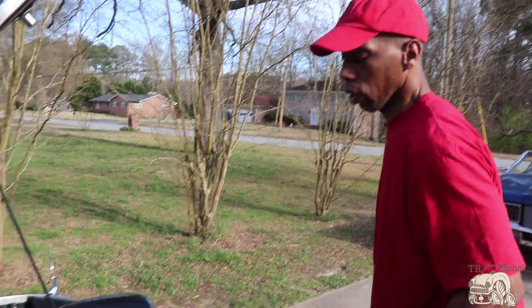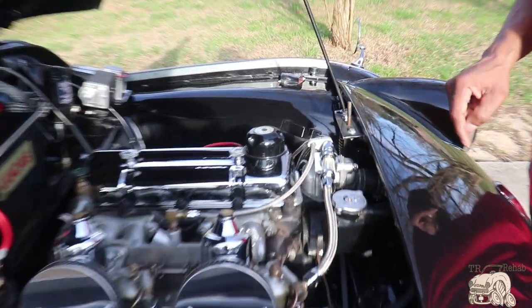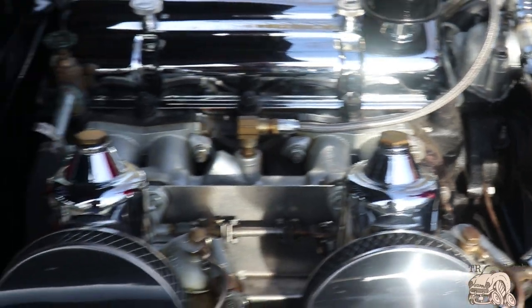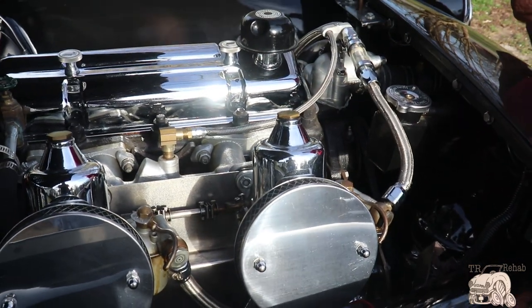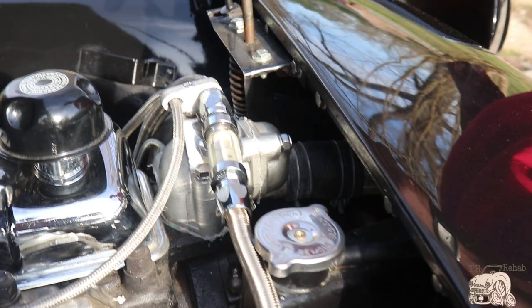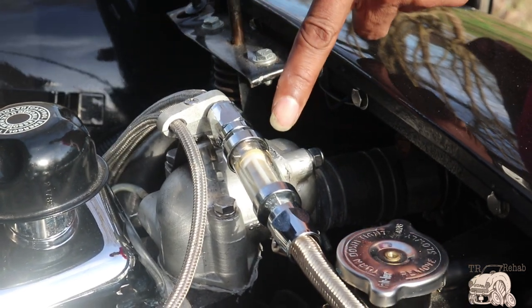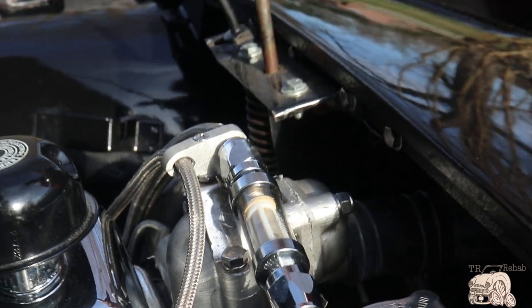Just as I suspected — when you don't need it to work, it works. But this is what was going on a little while ago. The bowl was empty, which let me know that the fuel pump wasn't pumping and both bowls were empty. That tells me either my floats were sticking, but what are the chances of both floats sticking at the same time with the same amount of fuel in each? So I go to my fuel filter, and look — it's starting to drain down. That's telling me that the fuel pump is not kicking in.